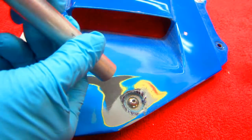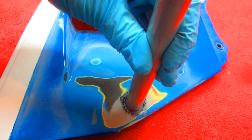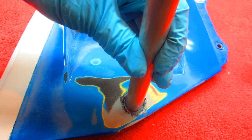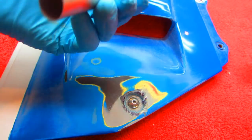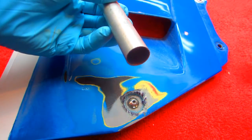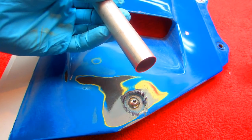Next step: I'm going to take the tubing over to the little jigsaw, cut a little sliver of it, and using CA get that right in place and do the body work with CA - pretty much similar to what we did. It looks like a piece of a lawn chair but I always have a bunch of this tubing in my inventory.